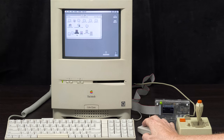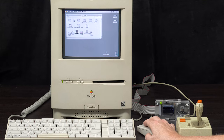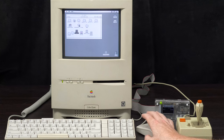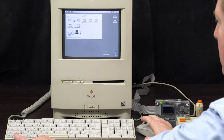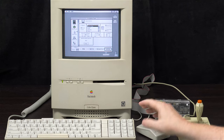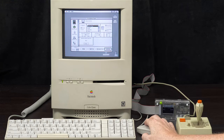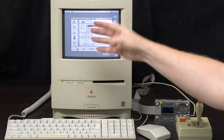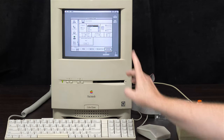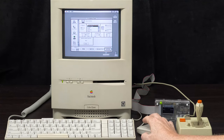The 2E Startup I'm launching now is version 2.2.2d1, compatible with this Mystic. I'll hold down the Option key to go into the 2E option panel. I always wish it would open directly to this without pressing the key, since you'll always want to tweak settings. I have the speed set on Normal, which means 1MHz for the Apple IIe clock speed.